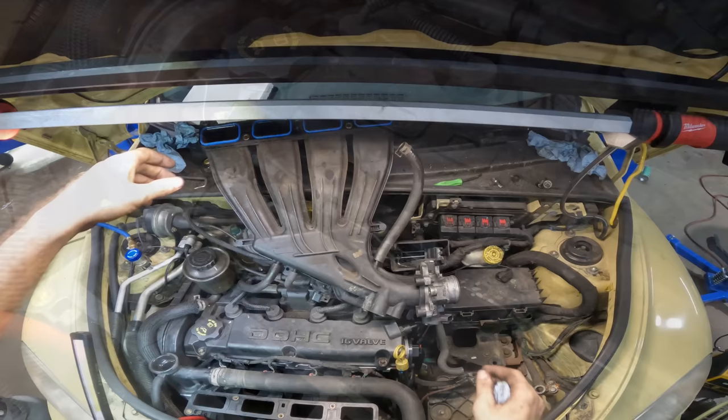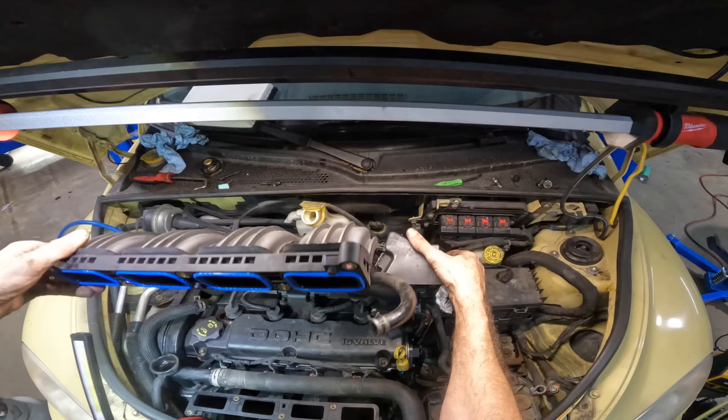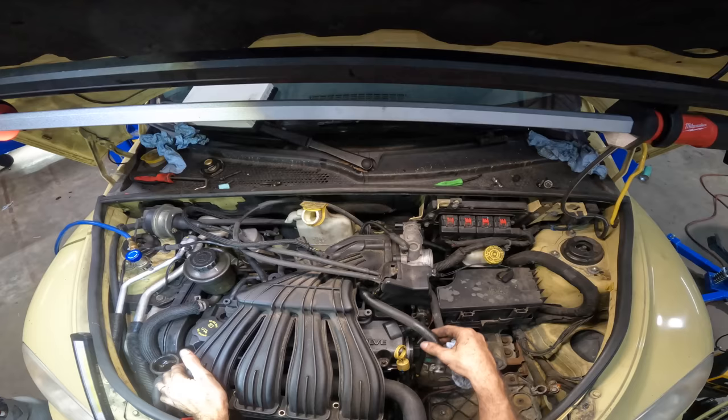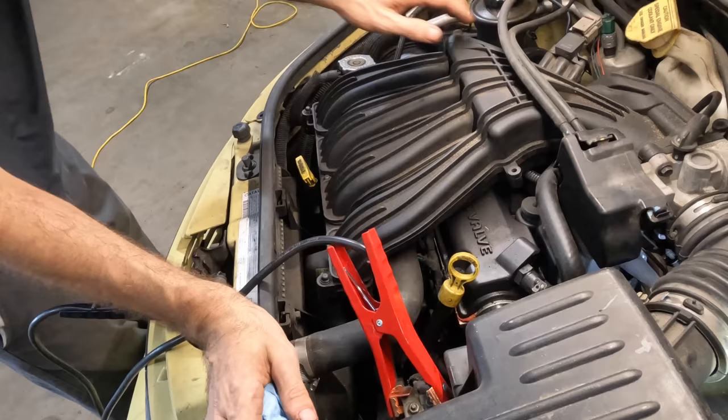All right. Okay, backing up some. Hose is on, injectors are in, lower manifold is installed. Let's get the upper in. Already put new gaskets on it. They're blue, so you know that they're good. It's not really much to get in. We flip it over and bolt it on. I do have to find a bolt for the backside though. Remember the ones that were missing and the whole unit was just flopping around? It's gonna break that intake. Just the vibrations of it driving around, it's gonna break this intake.